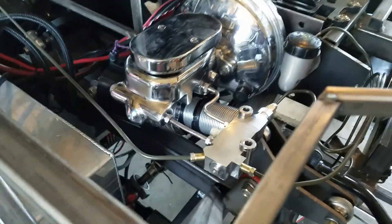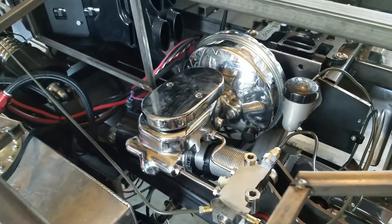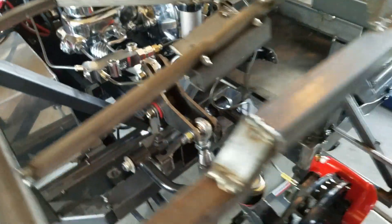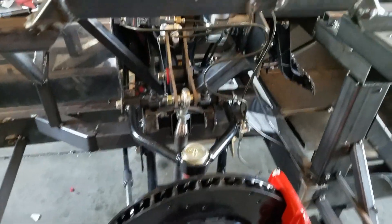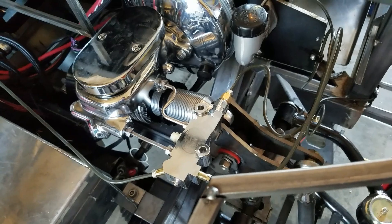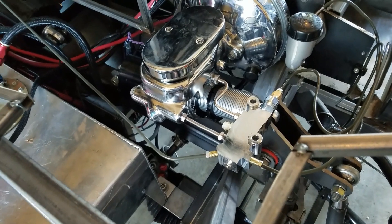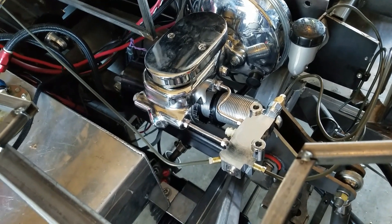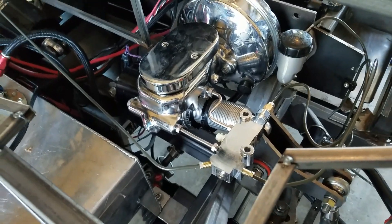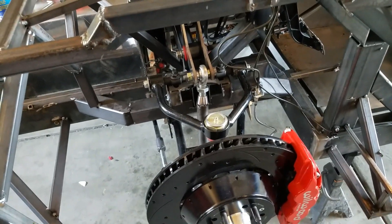When we first got it all together, I think every connector leaked. I looked online and found that some people say it's easy, don't worry about it — well, we didn't find it too easy. I saw a tip on one of the blogs: on a leaky connector, you loosen it, wiggle the tube a little bit, and then retighten it — don't try to just keep cranking down on it. That actually worked. So we now have a brake system that doesn't leak.